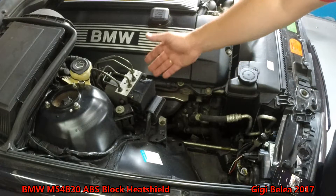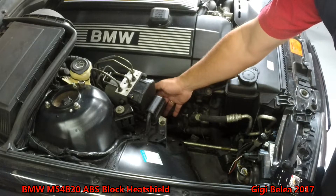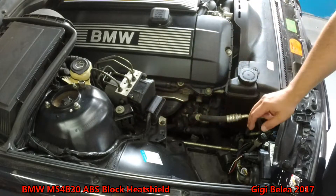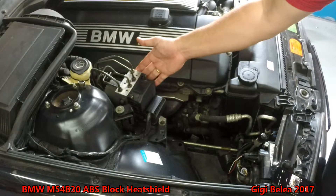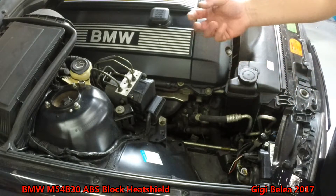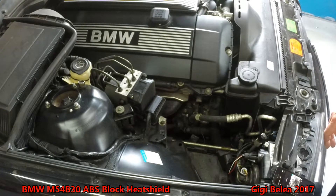So this is the engine bay, and here we have the ABS block — the ABS module. It's here just beside the exhaust. If you put your hand here you will feel that there is a lot of heat coming out. The module is sitting on some brackets and rubber rings to dampen the vibration, but over time with all the heat coming up and because of the vibration, some of the wiring inside the ABS module will get broken. Normally you should be able to fix this by putting in some new wires or fixing the existing ones inside the module.